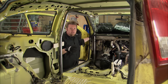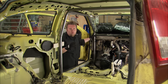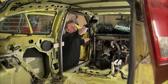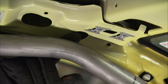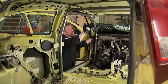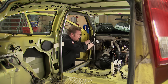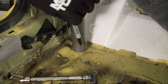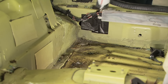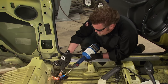One of the reasons I chose this particular type of roll cage is because there's an easy way to get to the top side of the joints to make sure they're fully welded. With just the hoop and the front bar, I can easily get to the top side of the notch. But when it comes time to install the roof bars and the front crosser, there's no way to get to the top of that joint. The rules say the cage has to be as close to the body as possible. The trick is to mark the location of all four main structure bars on the floor, hole-saw a 1¾-inch round hole, and drop the entire cage down through the floor to access the top side of all the joints. Then I'll jack the cage back up, slide the floor plates underneath, and weld them in.